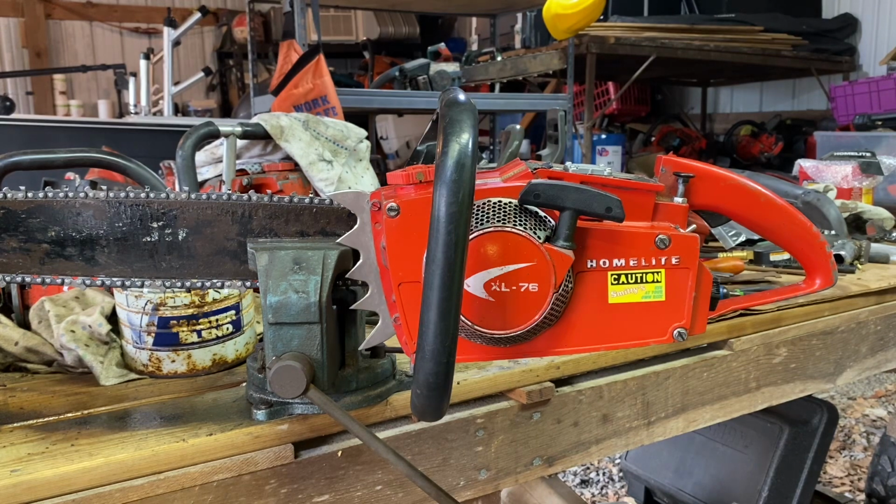That's a very interesting result. She's still lean. And that would mean that this 266 carburetor will not keep up with my ported Homelite. So I might actually have to drill this carburetor and open up the ports a little bigger to get more fuel. Huh. Very, very interesting. Was not expecting that.